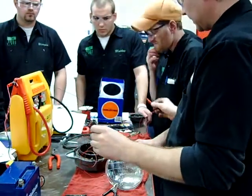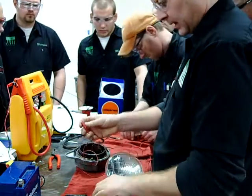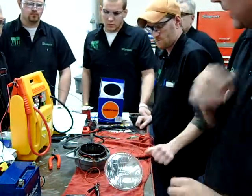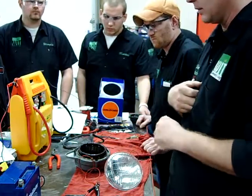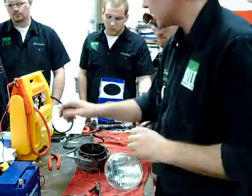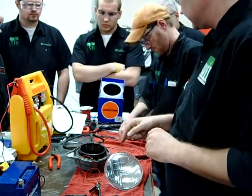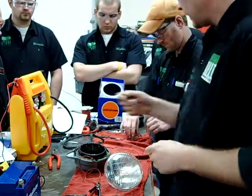Now we're going to hook up to any other lead — just take the next one over. And I'm going to hook up to the jump pack. Now, we are off. Since we're not going off the frame, we're going through a coil — when we turn this on, what should happen? Light. Now we also want to make sure our fuse is good. Hey, look at that! So now what Ryan will do is switch to the other lead — we do the same test, and it lights.